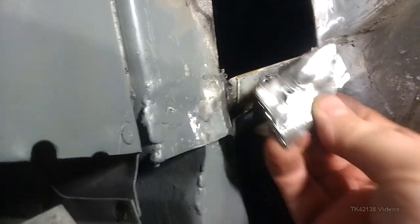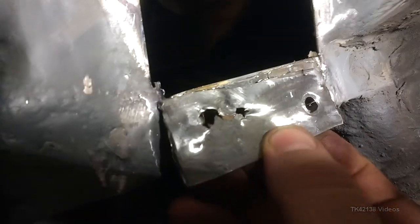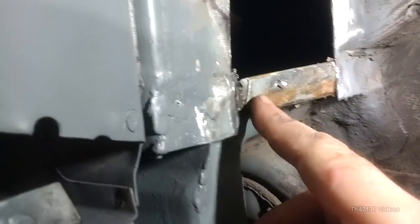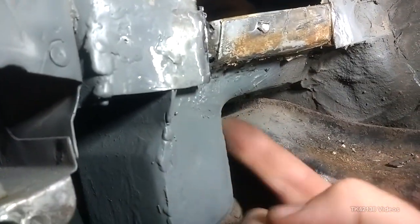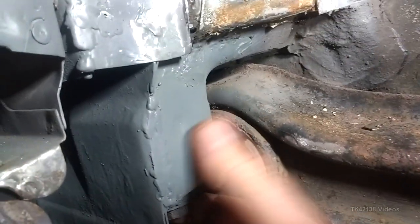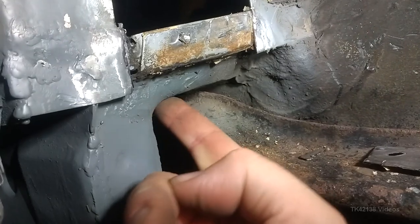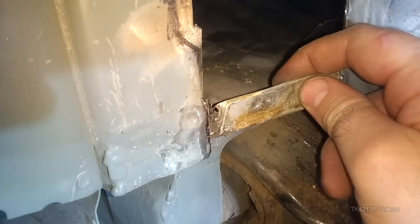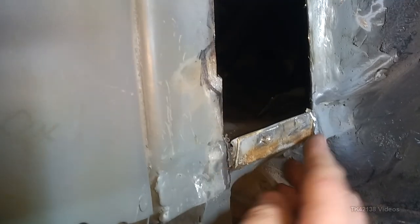So I trimmed this carefully off and that is the returned lip of this inner part of the box section for the suspension mount. The main bush is here and it's attached to this hugely strong structure, but this panel runs up here and then terminates here, and then you've got the floor pan edge. The floor pan here has a returned edge, so these are pinch welds together spot welded at the factory. This is the inner wheel well and that would also cover this bit, spot welded to this returned edge. There's quite a lot going on here.